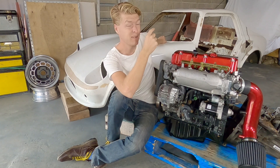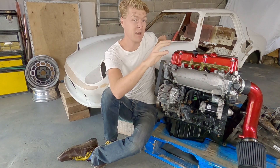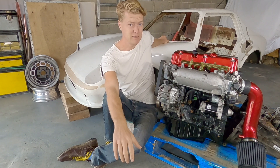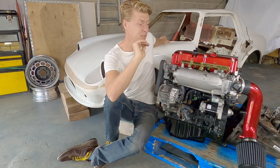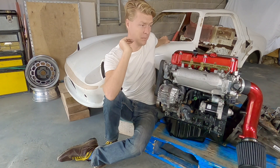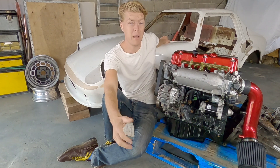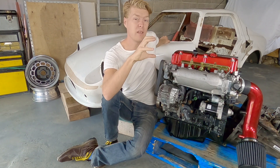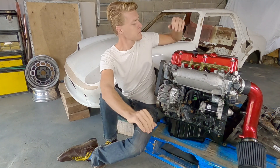If the car had come with an engine, that's what I would have done. Pandora originally had an MG Metro Turbo Mini A-Series engine, which I don't like. Mini Turbo engines get very hot, which is why she caught on fire. I'm in France, they're hard to get hold of, and I would have had to build or pay someone to build an engine. It would have been a lot of money, and at the end I wouldn't have had a lot of power. And in order to have a limited slip diff, I would have had to use a straight-cut gearbox, which I don't like in road cars.